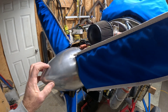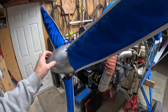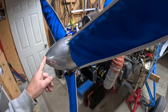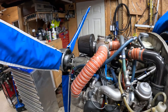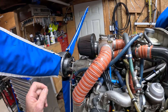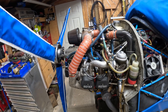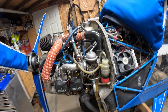It looks pretty good and I'm pretty sure I got it all centered. I built a little bulkhead at the end of the IVO motor housing to support it at that end — even though it's a very light spinner, it's probably not required, but I don't want anything cracking. I also had the in-flight adjustable motor out because I had a sheared carrier pinion gear — it's a tiny double planetary gear set in there — and I had to change that. The in-flight adjustable system on IVO's UL prop works completely amazing.